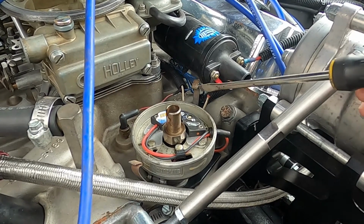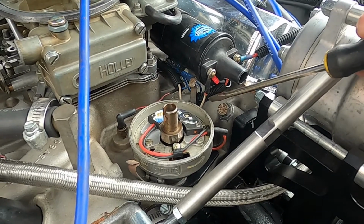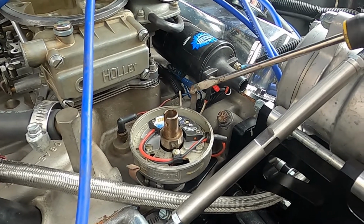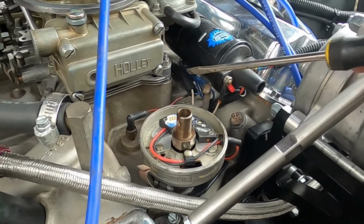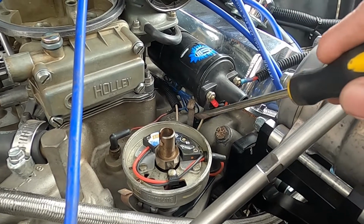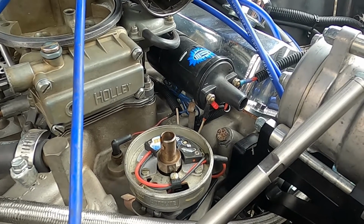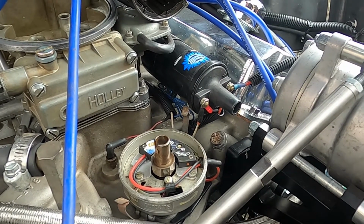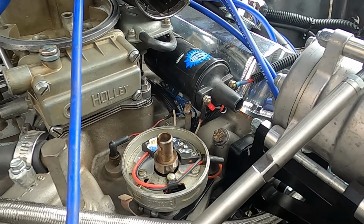And you can get rid of that. There's a lot of YouTube videos online that'll show you. You can put a little resistor or something here on the negative side of the coil to prevent the tach from jumping. But in all honesty, the best thing you can do is make sure that you have a good ground on the engine to the frame, a good ground to the battery, and you're using wire loom or something to cover up wires to prevent them from touching metal, to prevent them from grounding, or having any interference from the ground of the system. For the most part, just me running through here has been more than enough to eliminate any kind of tach jumping issues for me, and I did have them initially.